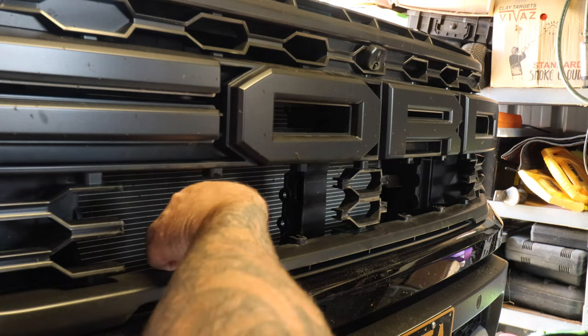So we're going to get a washer and put the washer on there. Make sure I'm putting the right washer on there. Yep, by the look of it. I'll just nip them up a little bit. I'll do the other side. So on the lights, the bigger bracket, obviously that's a smaller bracket, the bigger bracket goes to the outside on both lights. If you're looking at the front of the vehicle, I'm doing the left-hand side now, so it's going to go like that, with the foot going towards the bottom of the grill, facing the center. So just in that position, just there.